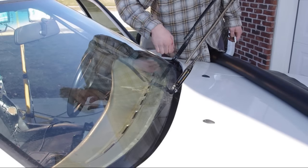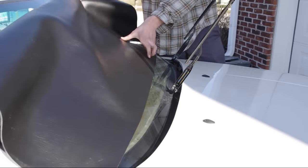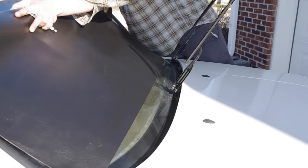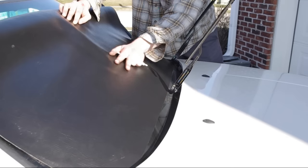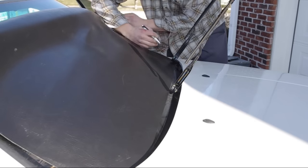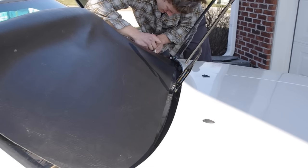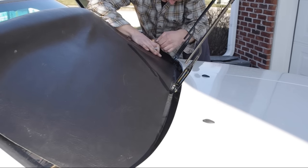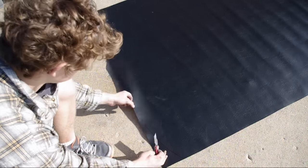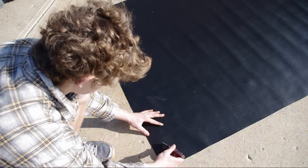Because the original dash came off in pieces after being so badly cracked, I'm going to come to the outside, throw the roll of vinyl over the windshield, and roughly trace it against the dashboard, then cut it out. Make sure you have enough extra material so you can cut away later for a better fit. I'm just taking a pen and marking where I think it should be, giving myself a little extra space. This is the same stuff I used in the Jet Ski Upholstery video — fabric on one side, vinyl on the other — and you can cut it with a blade or scissors.